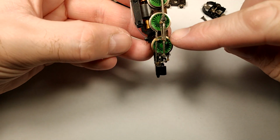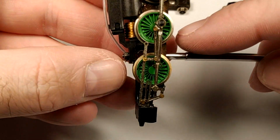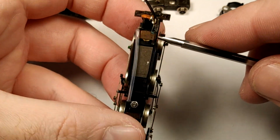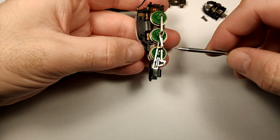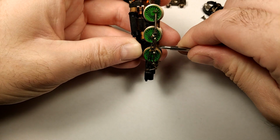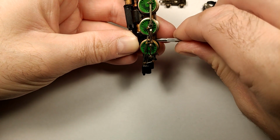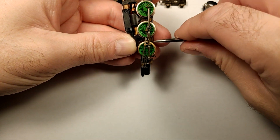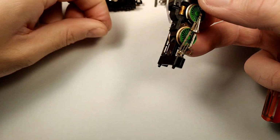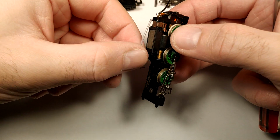And so this screw goes all the way to the other side, and there's a nut. And you'll see this wire that runs up and over, that goes to the motor. So I'm going to hold the nut with my finger whilst undoing the screw from underneath. This just prevents the nut from turning, which will allow me to undo the screw. Now the nut is loose, and that's just off. Now, there we go, there's the nut, there's the wire,